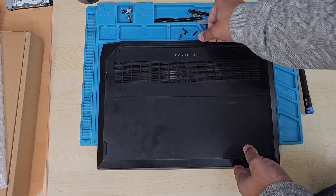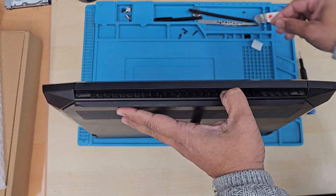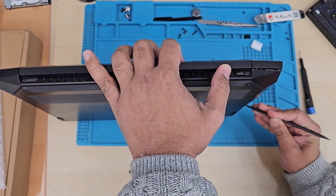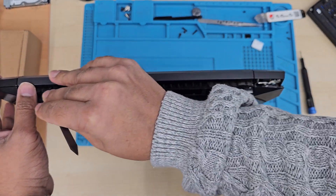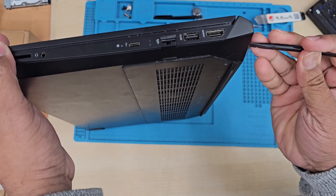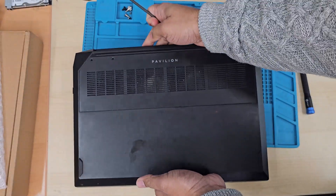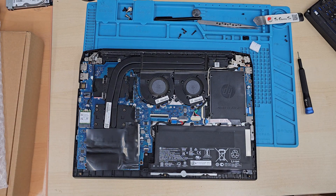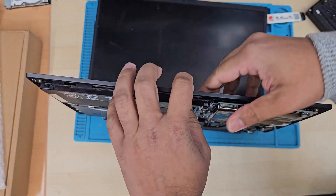After assessing this, if you find any sort of bad noise or it's not spinning properly — meaning the RPM is low — then definitely that is a fan issue. If the fan is fine, still check whether the thermal paste is okay or completely dried off; if so, you must clean it and reapply it. If you've done both and still see this message, which is very rare, then the problem is the actual sensor. In that case you don't need to worry — you can just disable the message from the BIOS and it should work.